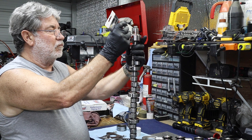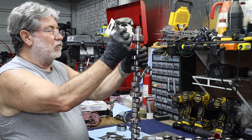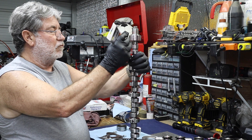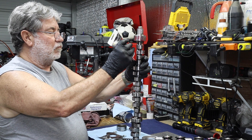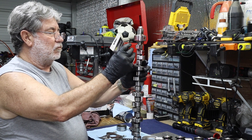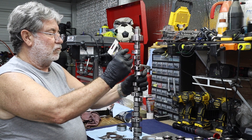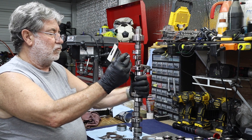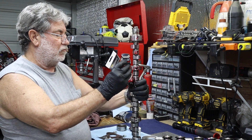Now, if you're looking at that bolt up there, that's not the factory bolt — that's all right, we're just getting it in place. We will tighten the factory bolt to the recommended 30 foot-pounds. With that in mind, we're going to go ahead and lube up each lobe — try saying that five times fast — and ensure that when we place it inside the block itself, we're not marring up any of the bearings.